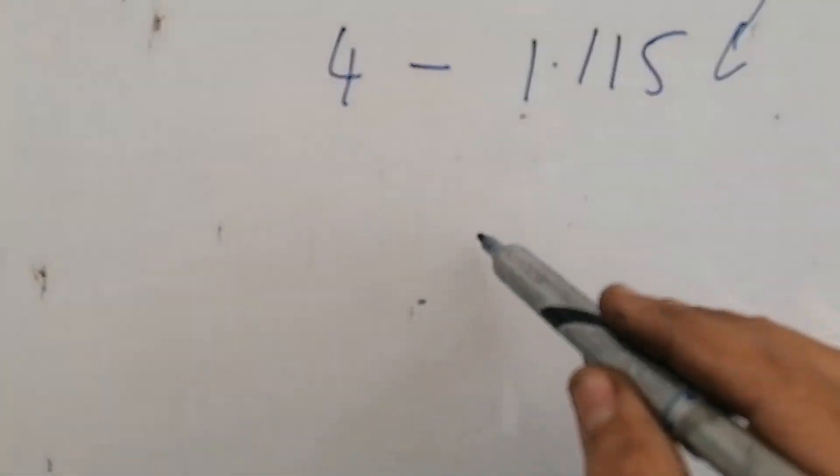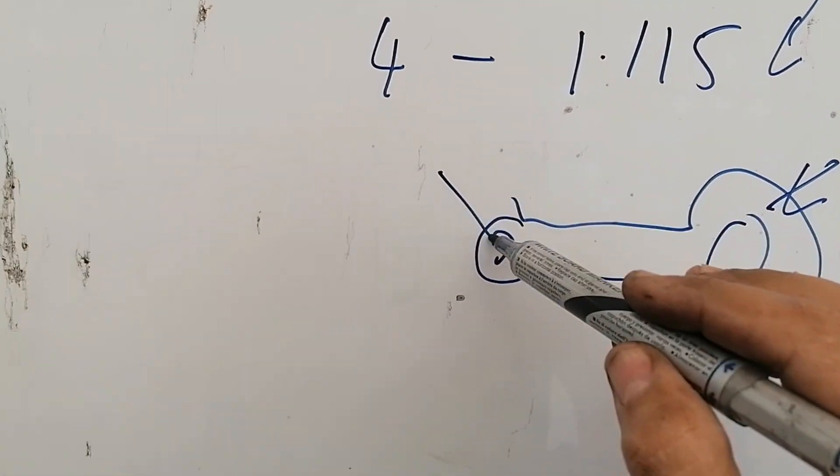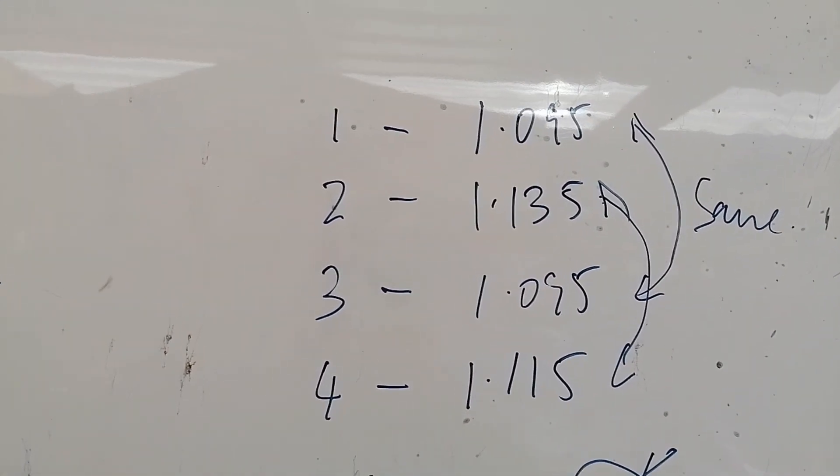Ideally you take the lightest at 1.095 and bring all of the others down closest to 1.095 - so they could all be 1.093 or something like that. Like I said, the ideal way is the conrod must be off, you weigh each end to see how balanced the conrods are, and then you weigh the piston assembly with the gudgeon pins - that's the correct way. But for experiment's sake, you can see how much the assembly was out. In conclusion, one cannot take for granted that all internal engine components are balanced - nine times out of ten they are not. This one is actually not too bad for a standard unbalanced engine. If you liked the video, give it a thumbs up, subscribe, and hit the notification bell. Catch you in the next one.